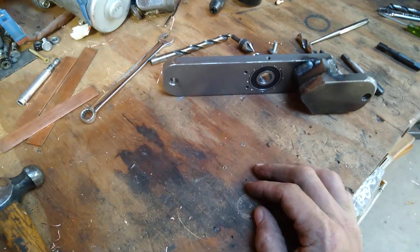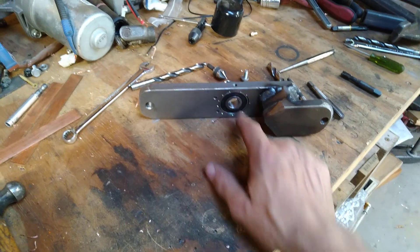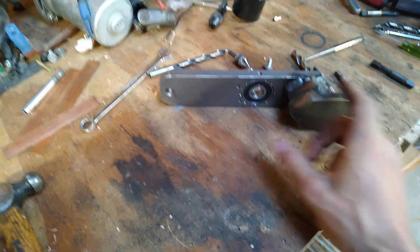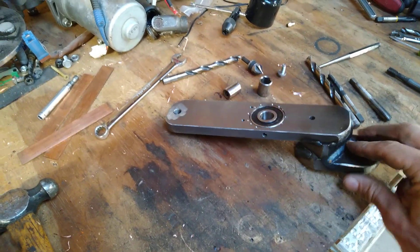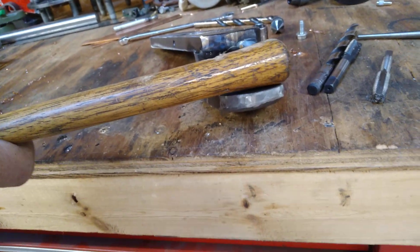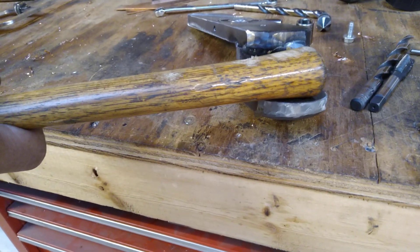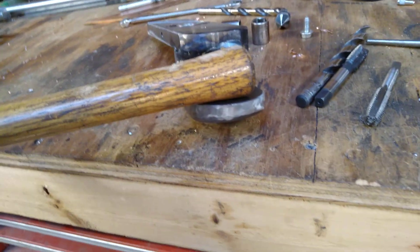Someone at work suggested I just remake this whole thing, and he's probably not wrong. There's also someone else at work who suggested that maybe I should have two of these instead of one — he was definitely not wrong. So I'm going to cut this off and I've got another heim joint coming. The problem with that heim joint is it sits about right here, so the heim joint's going to end up going down lower. I don't have any clearance problem, but what I don't like is that it's in single shear.